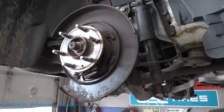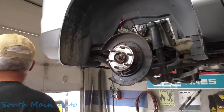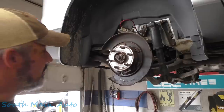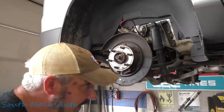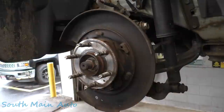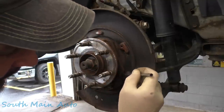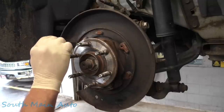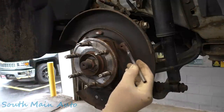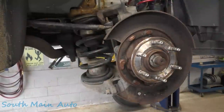Alright, beautiful. Well, now we just wait — that's pretty much all I can do for today folks. We don't have any parts, so it's going to be stuck here on my lift. Hopefully NAPA gets us the right stuff tomorrow. I've got the shoes and hardware which we can put on without pulling the bearing. Just like that, we're back — parts have arrived. We're gonna take and put a little anti-seize lubricant on these little slider pads. I don't know how important it is on a set of parking brakes, but if it was a set of drum brakes, you would definitely lube those areas.